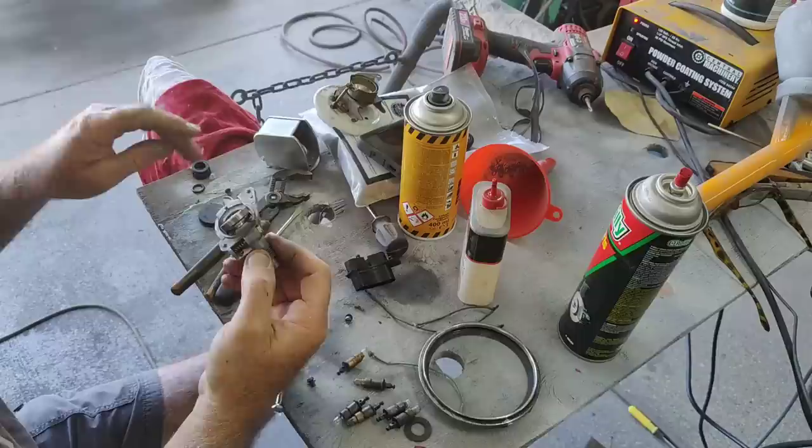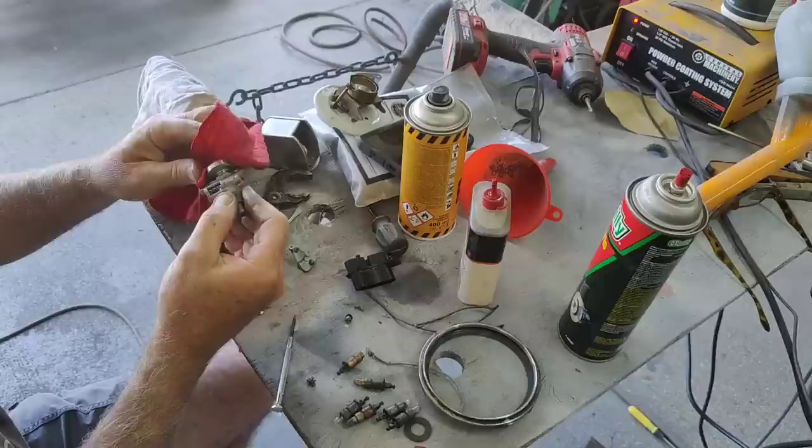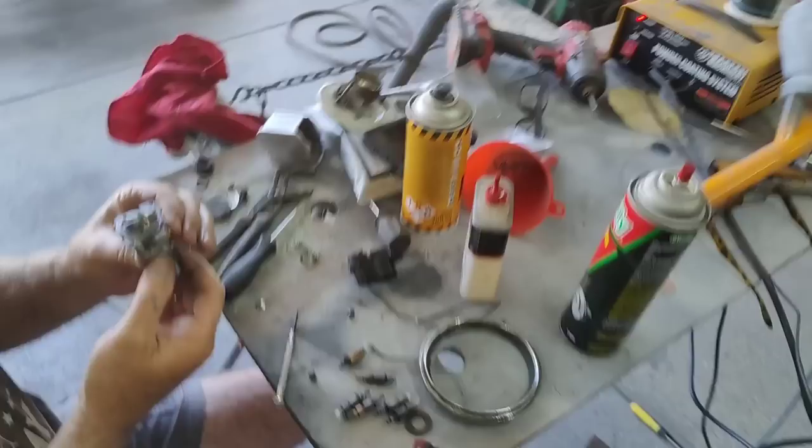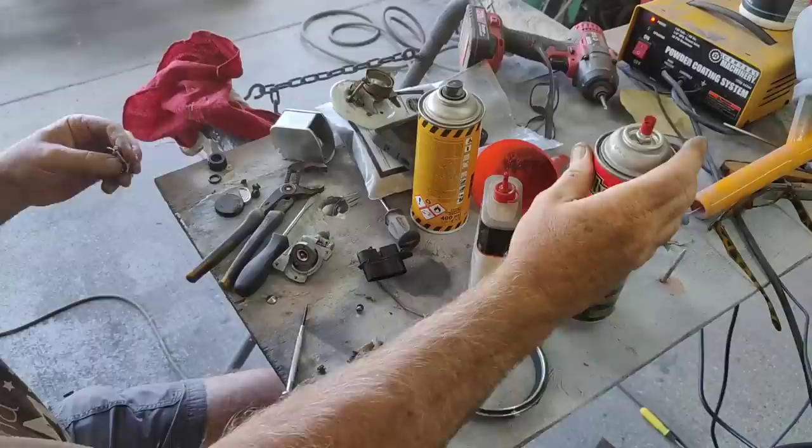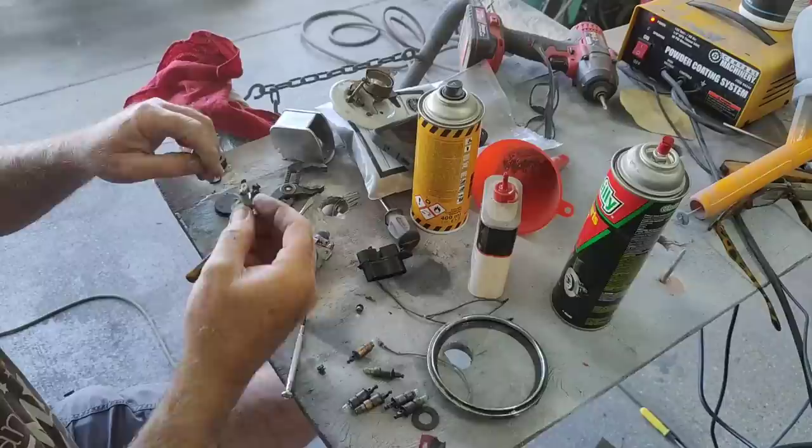And this wheel is clean. It's really important, you can't have any debris or anything on this little wheel. If you do, all of a sudden you'll see your speedometer go bow, just pop up, because it'll have a little piece of debris in there. So everything's got to be pretty clean. It's not that big a deal really, but it's best to just keep it nice and clean.